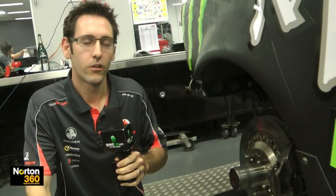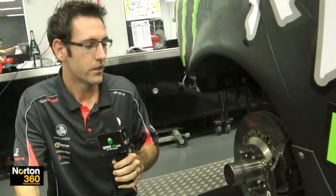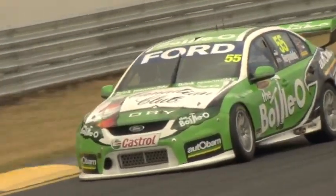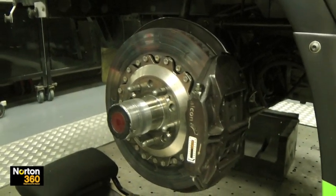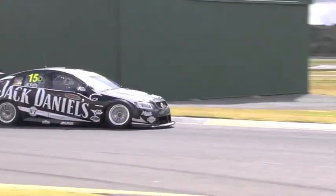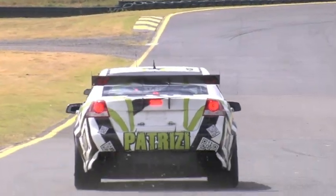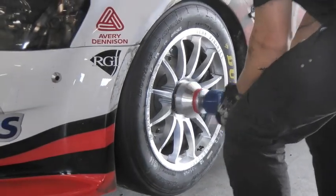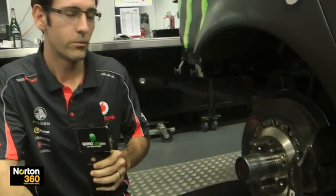On the rear, it's a control Alcon disc rotor, 343mm in diameter. In the category, you can only run three different pads on the back: DS3000, PFC-97, and RS4-4s. A lot of teams vary the different pads front and back to try to get different brake balances during the stop. It's quite critical to keep all four wheels either locking up at once, instead of having the rears go later in the stop and the fronts go at the start. So it's all about phasing the friction of the pads with regards to brake temperature and brake bias — trying to get the package working the best for each driver.